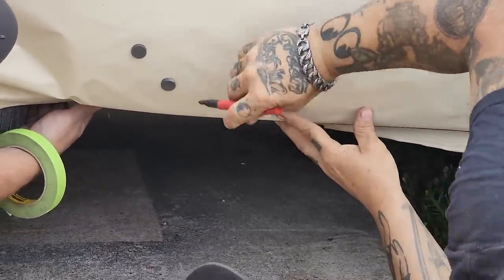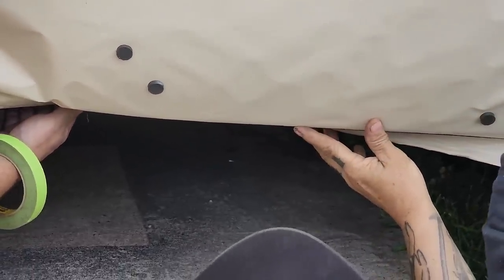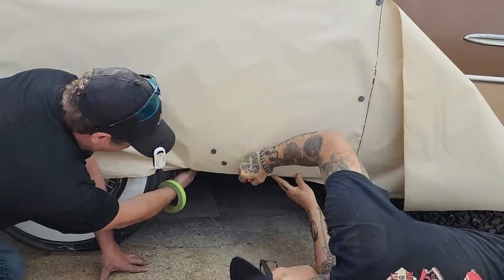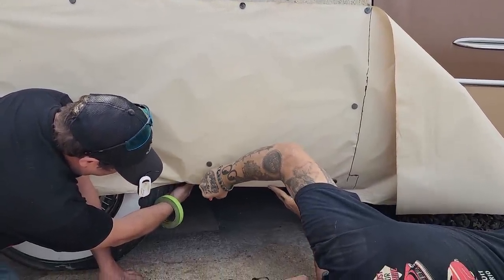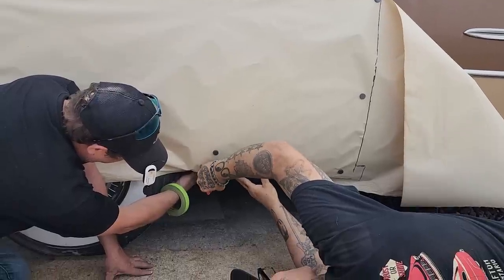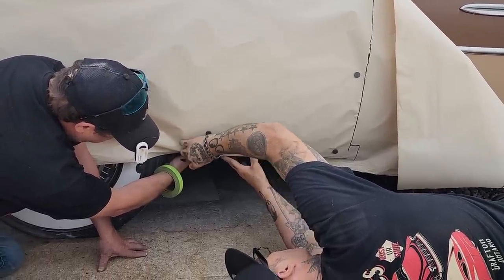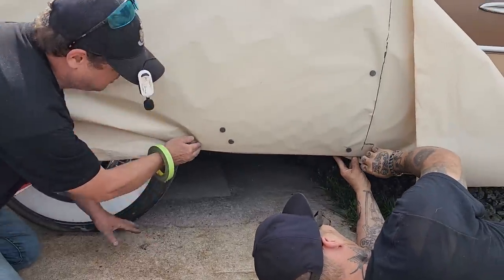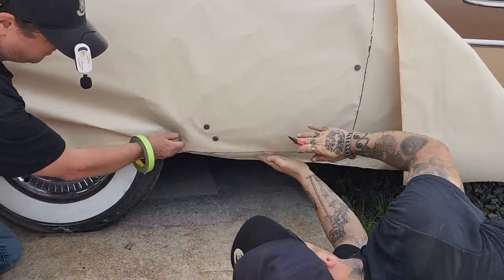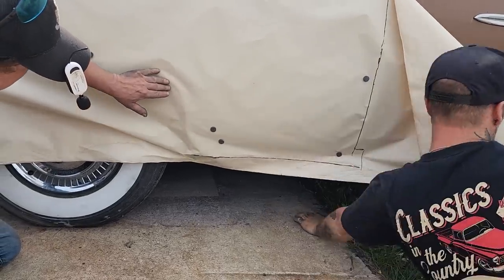What happens is we could have brought the paper down more to get enough paper to do that, but I really enjoy the metal that's up there. I don't wanna get down into that poopy metal. We can always add this on to our pattern, if you know what I'm trying to say. This piece over here can be added on with anything, basically. So that's where the quarter panel bends here, goes in, and then comes down and meets the inside sill.